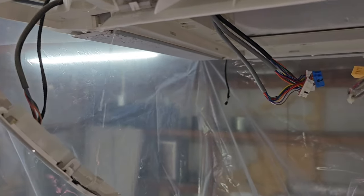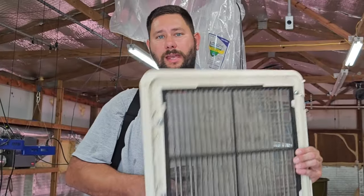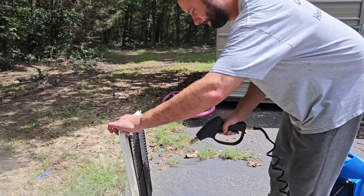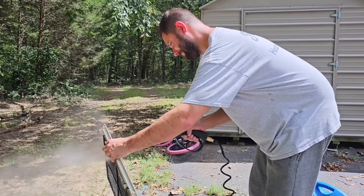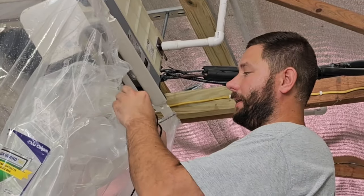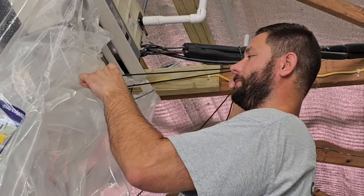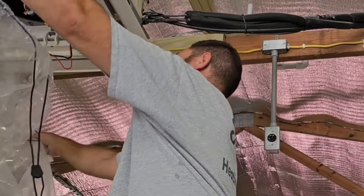All the water is going inside of the bag — that's really nice. Look at that dirty water! Now we can take the cassette filter outside and spray it off. See that dirty filter? Now look at that filter — clean. When you're ready to remove the maintenance bag for the four-way ceiling cassette, you've got a quick release button — just push it and you're able to release the tension on the drawstring and open the bag up and take it off.